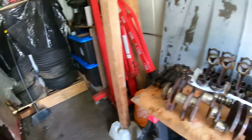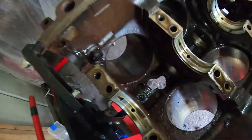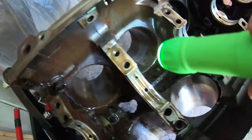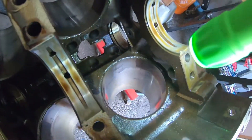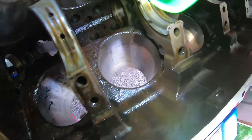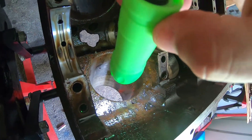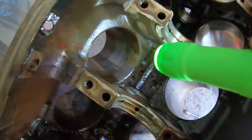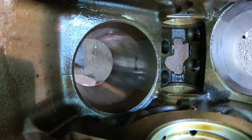I'll show you guys the cylinder walls here. I don't know how well you can see that, but there's a little bit of rust in there. They're probably gonna need a bore - maybe 20 over, 30 over or something. But if it wasn't for that one, they could almost get by with just a hone. I wiped them out last night after I got the pistons out and they honestly didn't look too bad. But this back one - both these back ones - are a little bit iffy. Not bad bad, but we'll see what the machine shop says once we get to that point. The fronts weren't too bad.